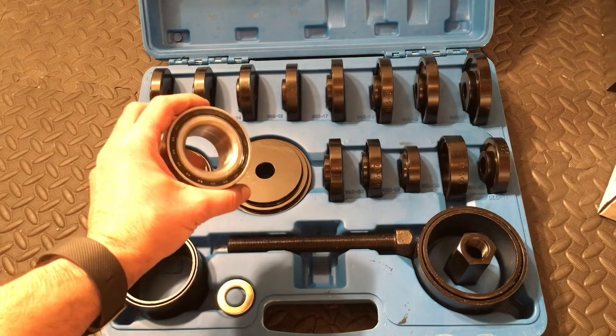Showing you what I did: we went ahead and put a plate here on the backside of the bearing, pretty much lining up along the edge on the knuckle. We went ahead, took the hub, greased up the shaft right there, and fed it in a little bit into the entrance there. We went ahead and put the tightening nut and the washer, grabbed an adapter that fits right there for the sides of that hub along that edge so we can start tightening it and pushing it in. I'm going to start tightening it by hand on this one — I don't want to use the impact wrench because I don't want to feed it in too strong since we're pushing against the bearing.